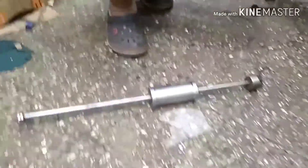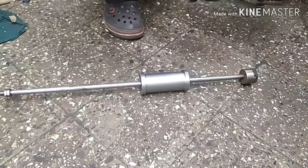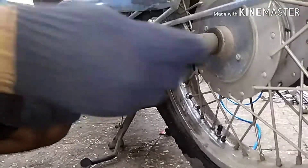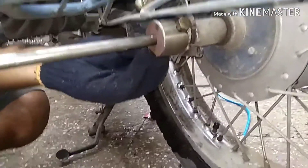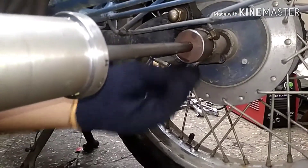In the workshop you can keep control on that. This is a sliding hammer which we have in the workshop — it's very easy to use. We'll just hook up the unit on the axle. This sliding hammer pulls outward. Now I'm going to hook up the tool in the axle — you just have to synchronize the hole of the tool and the axle, put the pin inside, and secure it with the nut.